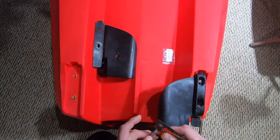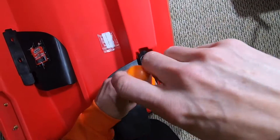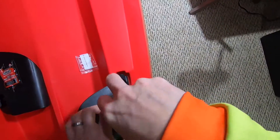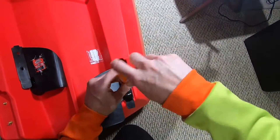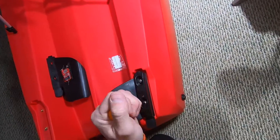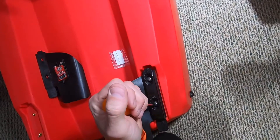This is not a glue. What this is meant to do is just make it so this will come off in the future easily without being bonded or corroded on. This boat is going to be in the water, so you want to make sure that if there's any corrosion on it, it'll come off. Especially if you're in salt water — salt water is really tough on stainless. Even though it's stainless, it's still going to rust, it's still going to corrode.